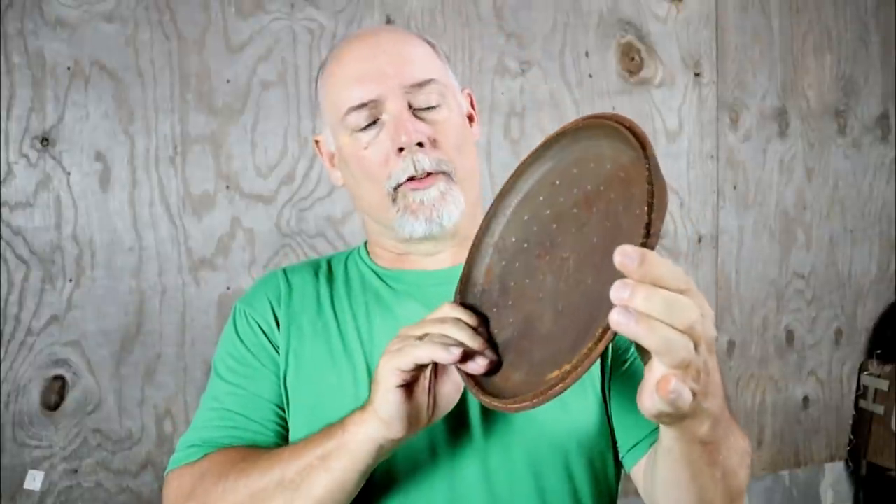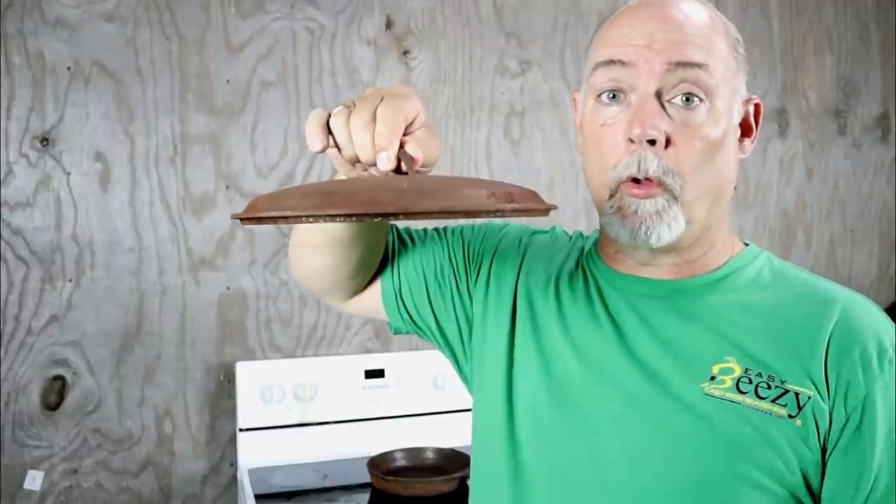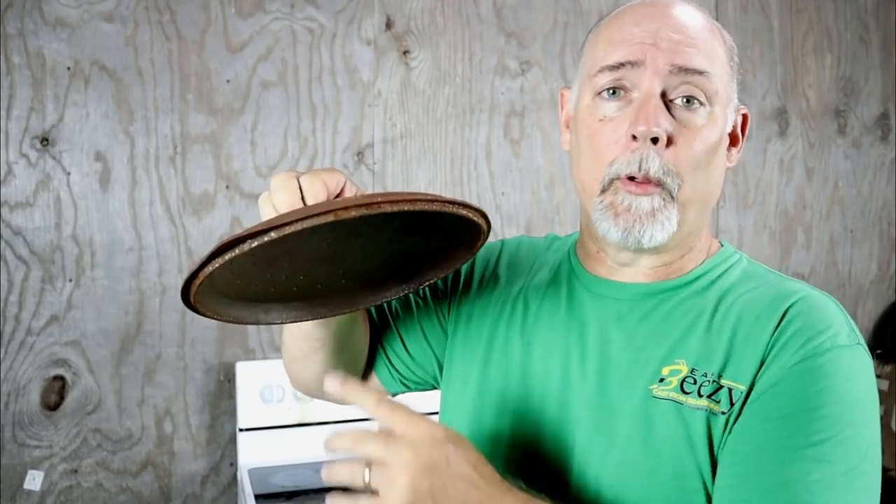There are a few things you really have to watch out for. A few years ago, my brother was cooking a pot of beans and he let the water run out. That heat from the cooktop just built up and built up until that excessive heat cracked the cooktop — it was just too much for it. Here's another thing that can cause problems: the lid. If you set your lid down on top of a burner that's on, the heat will build up underneath that lid to the point where it will explode your glass top. A friend of mine on Facebook did just that — he set his lid aside while stirring his gravy, placed it on a hot eye, and that heat caused his cooktop to explode. It can happen, and it will happen if you do that. So don't do that.